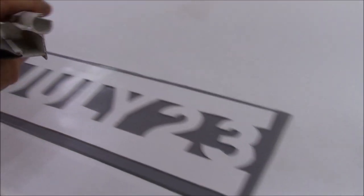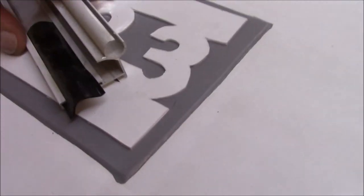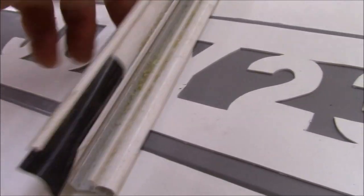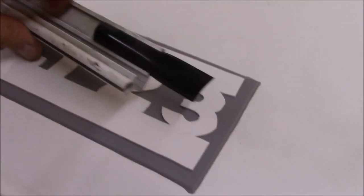These inserts and everything, we changed all that. Although we're not using black, I use this because it probably shows up a little better. This is your typical insert. All it does is just snap in. You see, it just kind of snaps right in there. And what I don't like about it is that the water can still travel down and go into that track. Where what we use is right here. It's got a groove in it. And that groove sits in this track here, so it's on the inside of the track and on the outside of the track. So it's on both sides, and it really does a much better job of keeping water out.